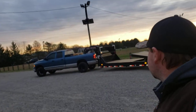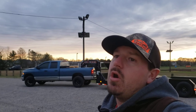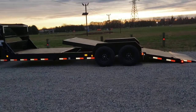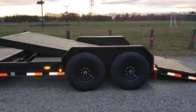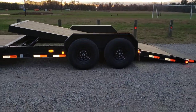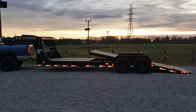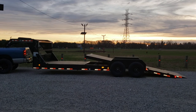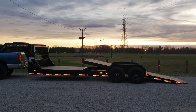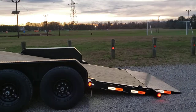So I chose this split deck combo setup to be able to do both. I can haul two small cars if they're really small, but really just one car and freight, or 25 feet of freight. That said, this is not a deck-over trailer, so you've got the fenders in the way — they are removable — but that's going to be the biggest limiting factor of my setup. I knew that going in and decided it's something I'm personally willing to give up in order to have a tilt deck with an awesome loading angle for low cars, and I never have to fuss with ramps.